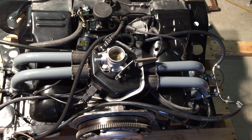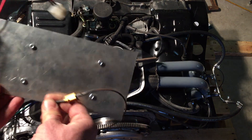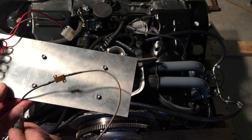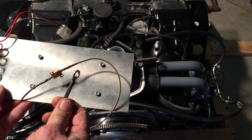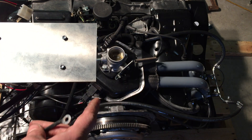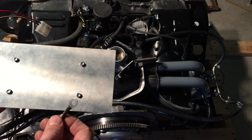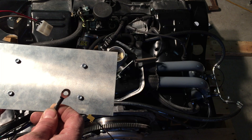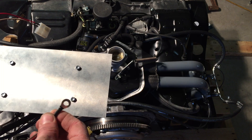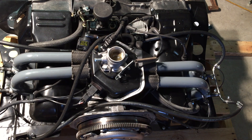I also have this little resistor — that's for the idle air valve. It just controls how much it closes. And then this ground ring connector goes somewhere near the relay board, usually forward and down below, but it moves around on different years. There's a ground lug there, so you can just take that nut off, clean it up while you're there, clean up the other connections, and then add this to it and lock it all down. That supplies all the grounds for the unit.